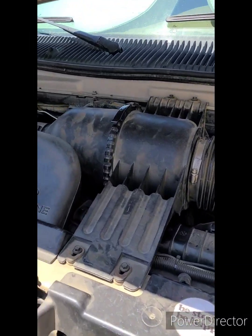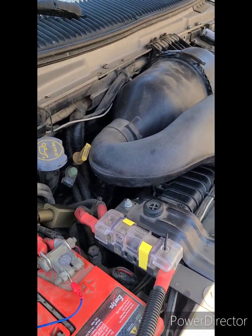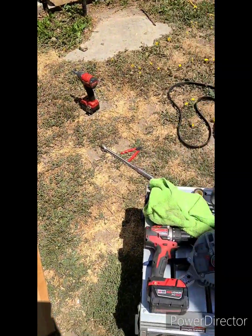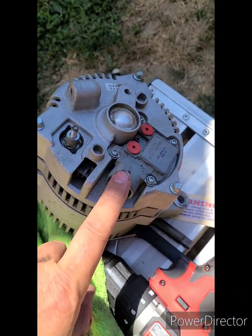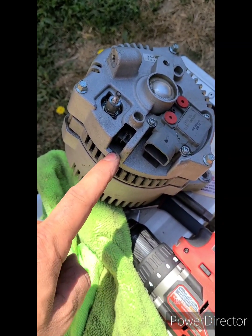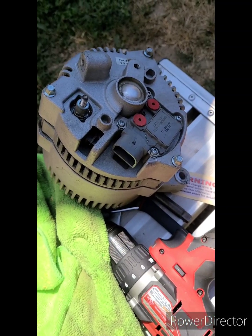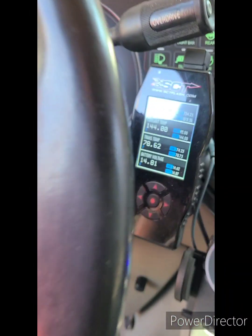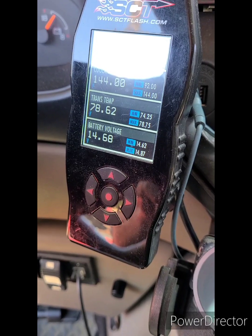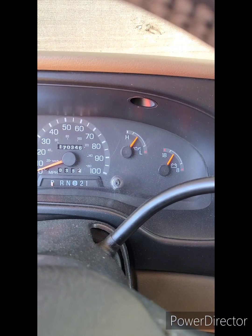All wrapped up, done — idling properly right at 14.8 volts or higher, which is perfect. Interesting to note: the original alternator has a main plug and then a single white wire plug — that's the stator tap plug — and it is no longer used on the new unit, it's not needed for the new system, so that's just floating in there. Otherwise good to go. Voltage at the OBD port: 14.8 volts. Voltage at the amplifier on the back: 14.8 volts. Looking very solid — we'll give it a stress test and see how it goes.